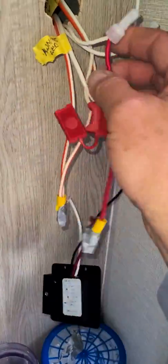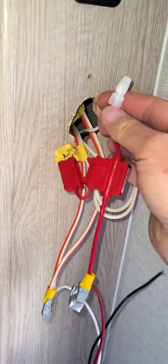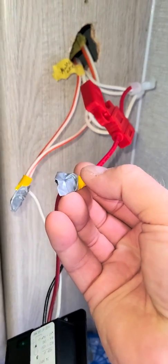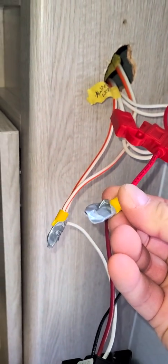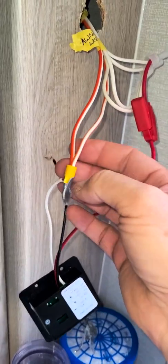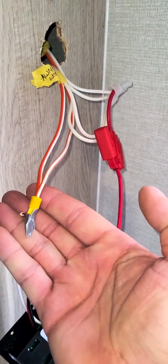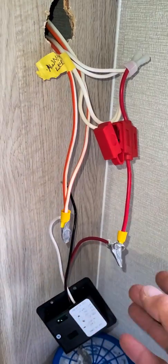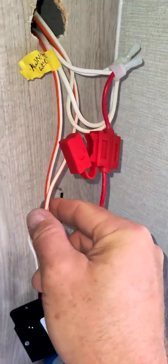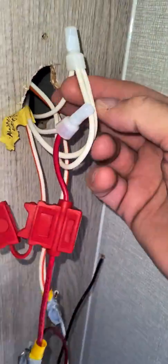Another assumption is that the blue-white is attached to a 5 amp inline fuse. So the blue-white is pigtailed to the 5 amp fuse, which has a spade connector on it, which plugged into one side of the original awning light switch. The other 2 orange-white stripes also are pigtailed together and were connected to the other spade connector on the original awning switch. So that seemed to be the circuit interrupter between the fused line and the pair of orange stripe cables.